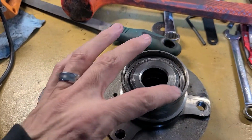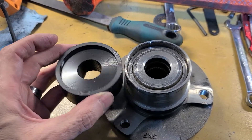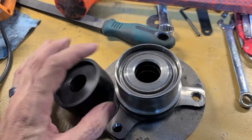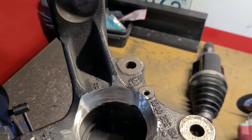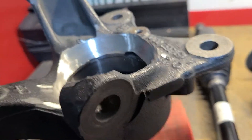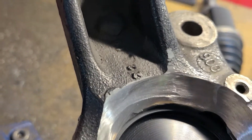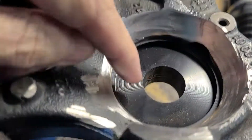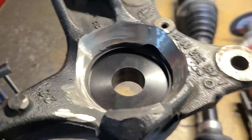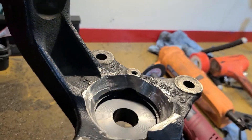Just so I wasn't grinding with the bearing in, I made this plastic piece with the same dimensions — step down from here to here — so this goes into the hub. That represents the actual position of the hub, and this is where the surface of the CV axle sits up against.